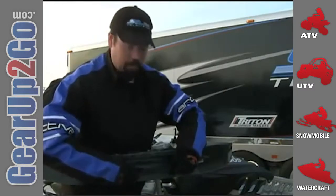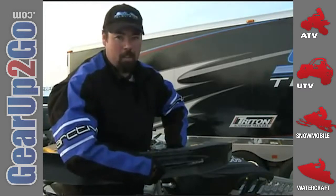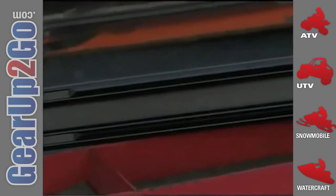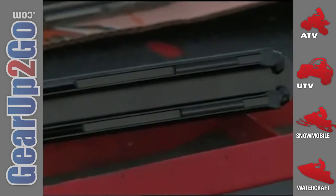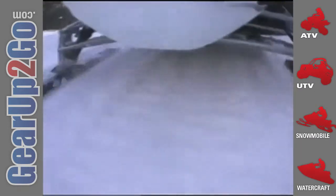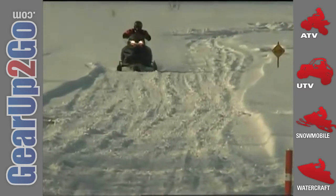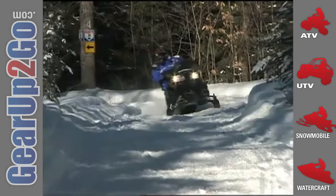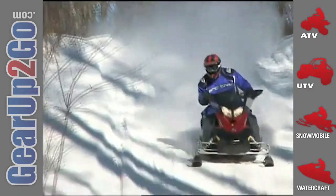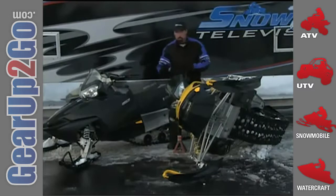If you ride on hard icy trails, carbide is your friend. For the way that I ride, I usually find a six-inch carbide will do. The more aggressive you get, the more the ski will dig in, and this translates into a heavier steering feel or possibly a little bit of nervousness or twitchiness in the corners, both of which can be fatiguing on a long day's ride. There's also the choice of twin bar type runners, like these Woody's Duallys. These can be a real benefit on sleds that have a tendency to dart around — the twin design cuts new grooves into the trail instead of darting around ones left by the guy in front of you. Basically it's a personal choice as to the type and size of runner that works for you and your sled. If you're still not sure, ask a tech support line or somebody else riding a sled just like yours. Whatever way you go, remember these things wear out, so check them often, especially when you're in less than ideal snow conditions.